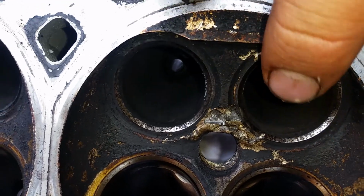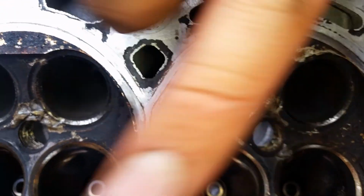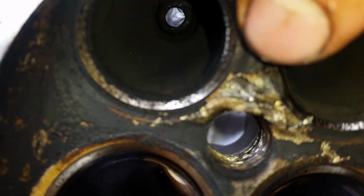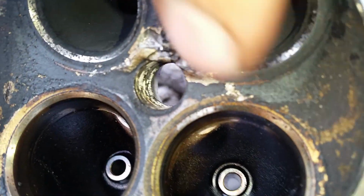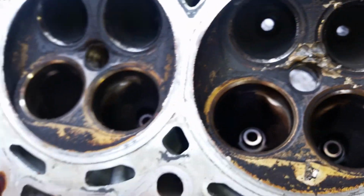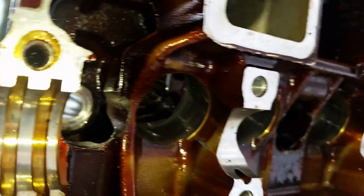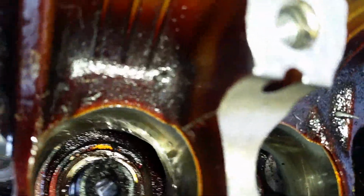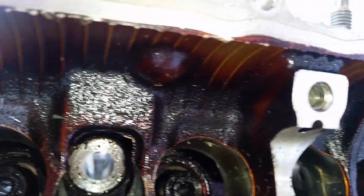However, I don't know how this one's got less damage than the one in cylinder 1, because that had 2 snapped off. This one had 1 snapped off. Well, I suppose how it snaps makes a big difference. So they're pretty deep grooves there. So that's not too bad. If I turn it over, which is very difficult one-handed, by the way. You see, this side's looking pretty good. It's nice and orangey brown. It's not too burnt. And then we get this side, and it's chunky, dirty, exhaust burnt, black, filthy. Put oil in your car, fellas.